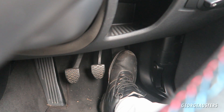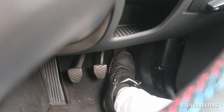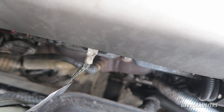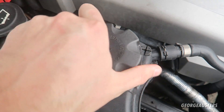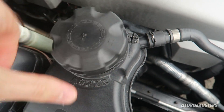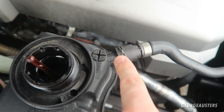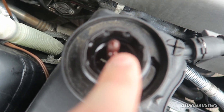Once the fan is on and the heat is at maximum, step on the accelerator pedal, push it all the way down to the floor, and hold it for 10 to 15 seconds — we'll hold it for 15 to be safe. Then let go, and heading outside you should now hear the electric water pump kick in. If you take the cap off the reservoir you should see water and potentially air squirting from the pipe here — this is the highest point where air and water get pushed to, and it squirts back into the header tank.